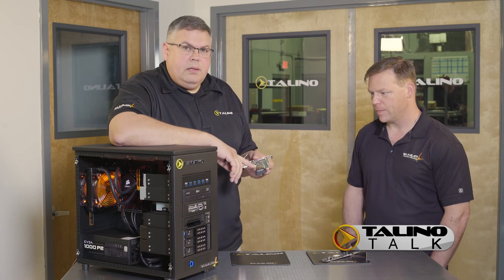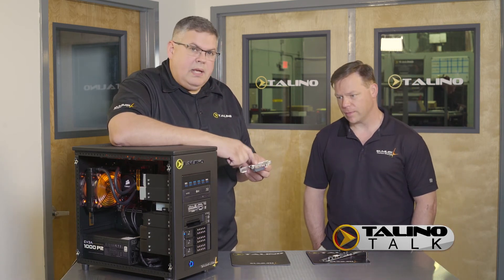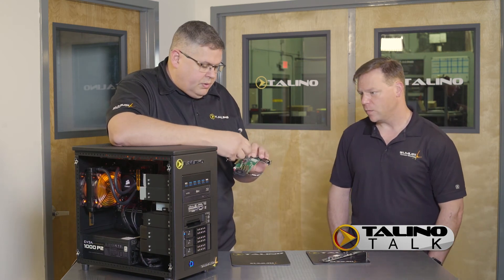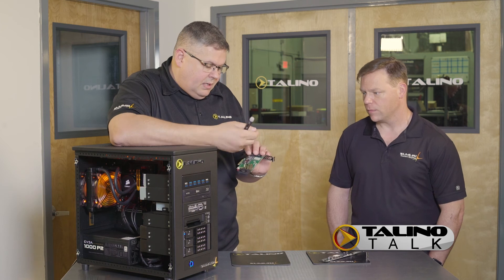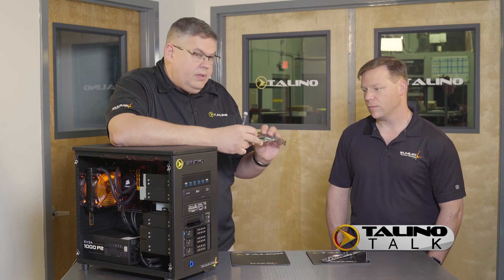What makes it great is that I've worked with a lot of these before where the vendor will put a RAID chipset on the actual board and try to RAID the components together via the card. The chipset is lousy so you don't get good speeds — in my previous testing it was around 700 to 800 megabytes a second. With these it's much better because you're using Windows and relying on the speed of the M.2 SSDs themselves rather than the controller chipset on the board.